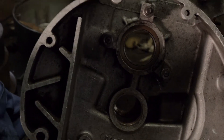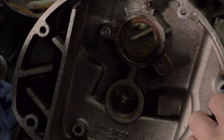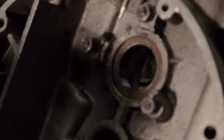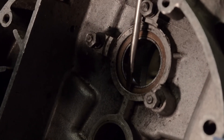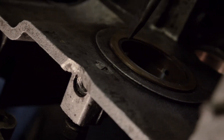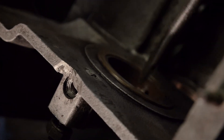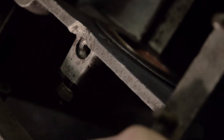This has been designed to basically tighten up the fit between the bearing housing and the crankcase. Unfortunately, they have put it in the wrong position, because the distance between here and here should be exactly equal to the distance between here and here. This bearing housing and thrust assembly is too far in this direction and would need re-jigging.